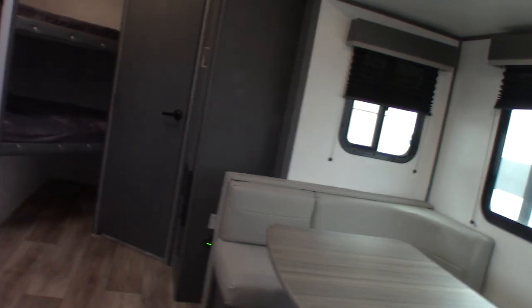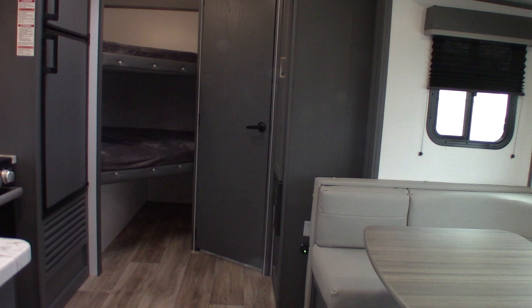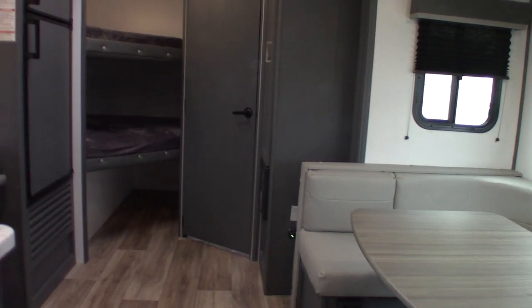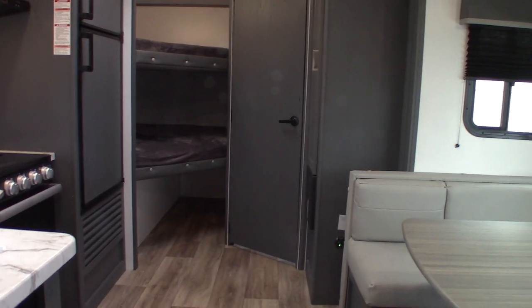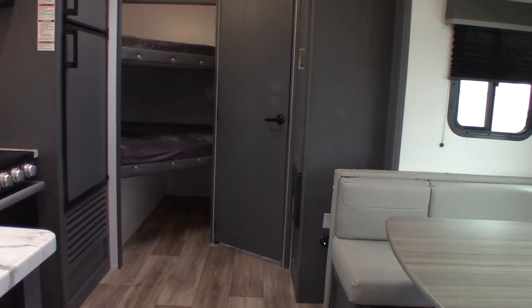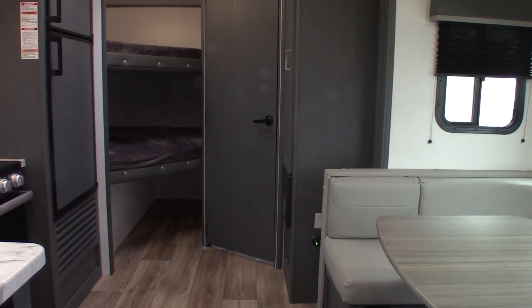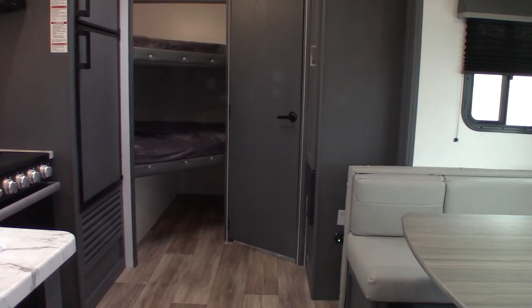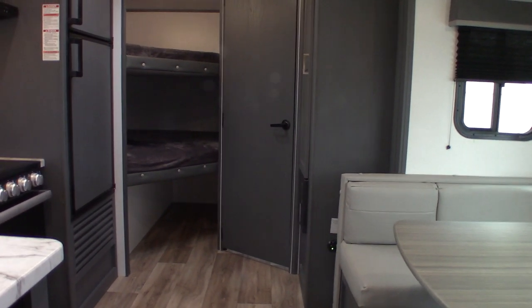I think that covers it. I want to thank you for purchasing your trailer here at National RV Detroit. Please remember to inspect your roof regularly every 60 days — a few times a summer — and make sure everything is in good shape up there. Right now this trailer's winterized, so all the water's been purged out and replaced with antifreeze. The water heater itself is bypassed and empty. Before you turn the water heater on in the spring or summer, make sure the water heater tank is full with water. That's important. Thank you.